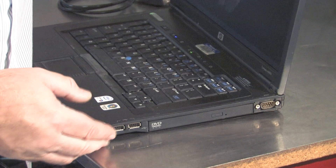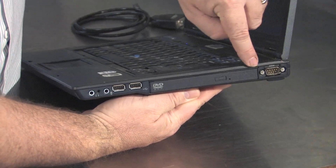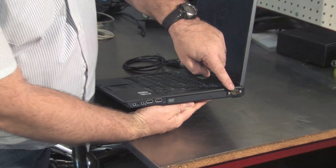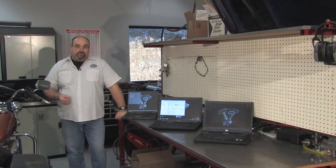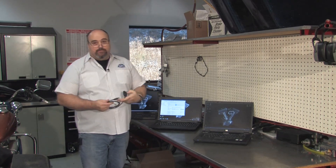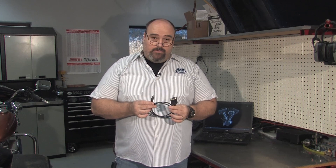The computer that I will be using today has both USB ports and the 9-pin serial connection port. If your computer does not have a 9-pin serial connection port, you will be required to use a USB to 9-pin converter. If you need to use a USB to serial converter, we suggest looking for a converter that contains a chip manufactured by FTDI or Prolific. These can be purchased from Amazon.com or Best Buy. Radio Shack brand Gigaware converters are not recommended due to driver issues and are not compatible with S&S modules.